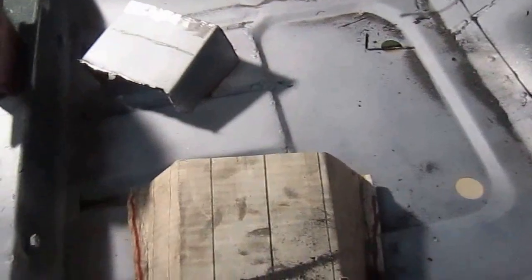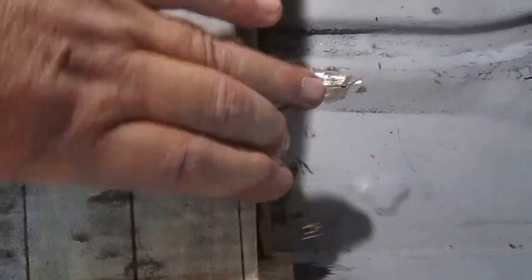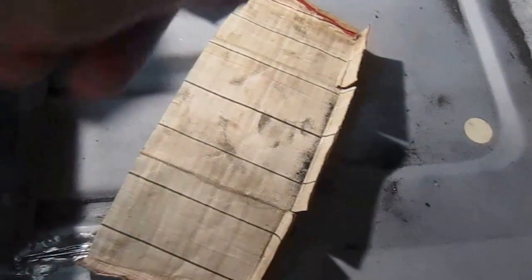What I then did — I guess this is a little bit like Project Binky but they're far more professional than I am — I made one of these cardboard templates which basically fitted in like that. Very rough, I mean they do them really nice, but it was enough to get the shape that I needed. And then I basically popped this down and cut the metal around it and then folded it.